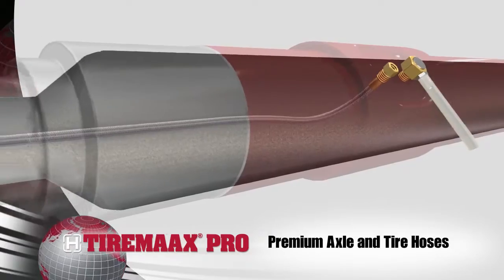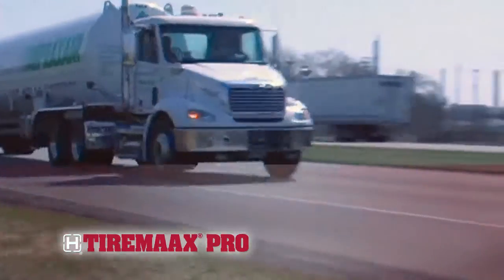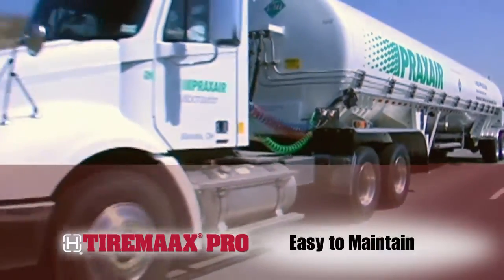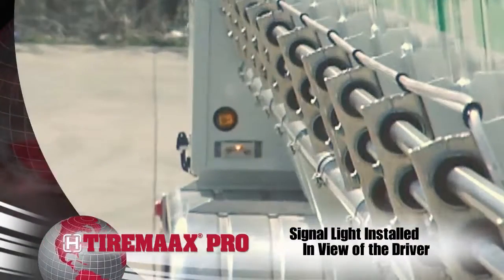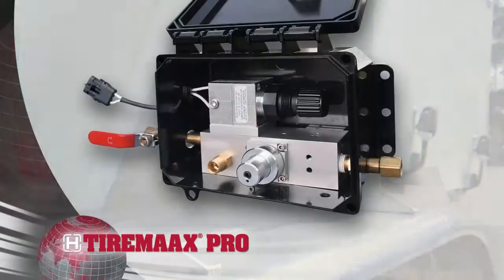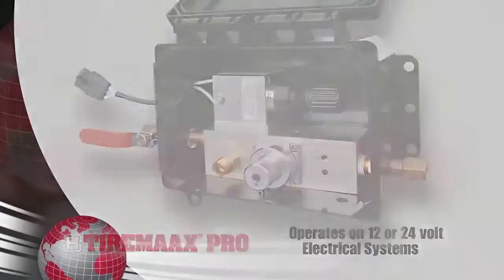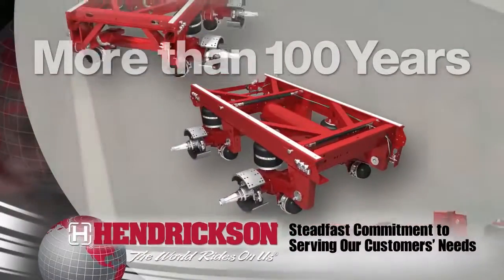Axle air lines, delivery lines, tire hoses, and other plumbing components are proven designs with millions of miles of real-world applications. With robust components and no electronics, transducers, or pressure switches, TIREMAAX Pro is easy to maintain. A signal light installed in view of the driver notifies the operator of TIREMAAX Pro's system status and maintenance requirements. The versatile TIREMAAX Pro system is easy to adjust by a technician and operates on either a 12 or 24 volt electrical system.